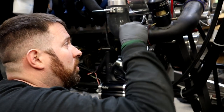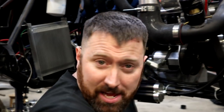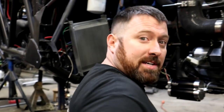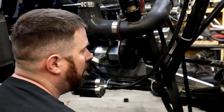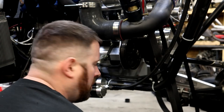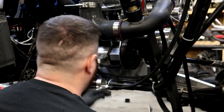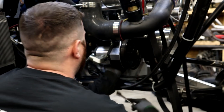I'm cranky — look at the camera — I clunked my head right there. It didn't feel good. But the bracket is now within a tenth of a degree vertically and it's square horizontally. To square it horizontally, we put this straight edge in here, laid it against the inner pulley — it has two points hitting on the crank pulley and two points hitting on the power steering pulley, and we know it's square.